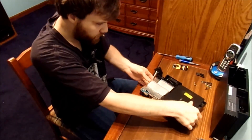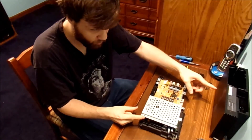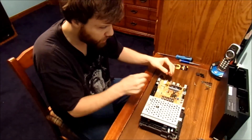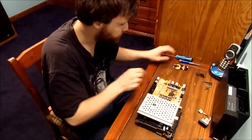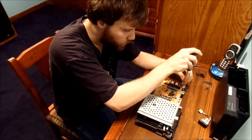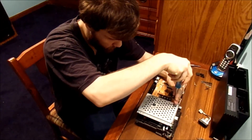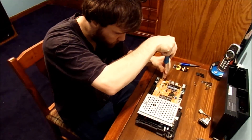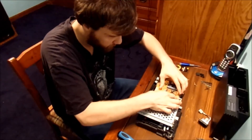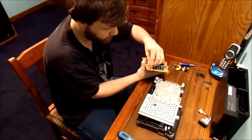Hopefully, we take off the power supply. To do that, flip the system over. Warning: if you're going to be messing around with this PS2 console, be very careful with the capacitor or any type of ports on this. De-clip this, move that off to the side, and unscrew all four screws for the power supply. Make sure you don't mix up any of your screws. Handle the power supply carefully because you don't want to destroy it. There's your power supply.